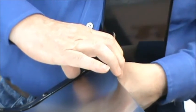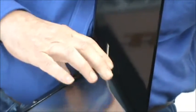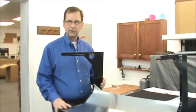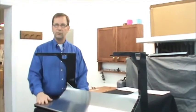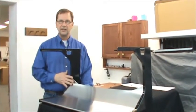Now we'll come back and put the next one in, gently bringing that deflector up as we go. Do the same thing for the remainder of the three screws. Once we have all the machine screws in place, go back and re-tighten each one of these screws on both sides. It's not necessary to over-tighten them — just bring them up until they appear to be snug.